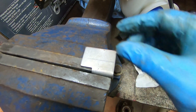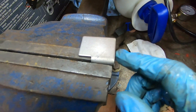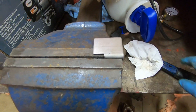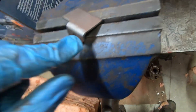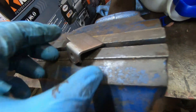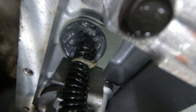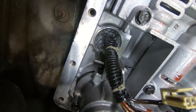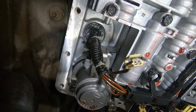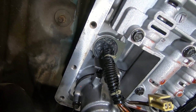When first installed, there was still a millimeter of play and I didn't want any of that. So I put the end of the bracket in a vice and re-bent it so the length between the bolt and the contact point is longer — essentially moving the position of that 90-degree bend. Now it's holding the connector housing up, and even if you push on the wiring harness to connect it, the connector won't fall down. It should have come this way from the factory.